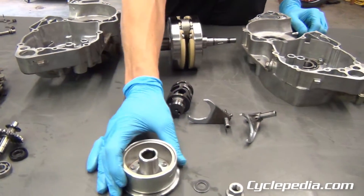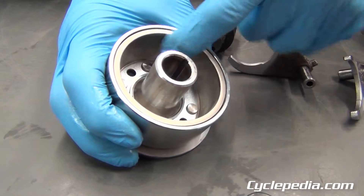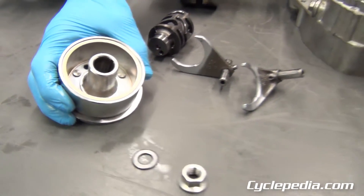Over on your rotor, you don't see it a lot, but sometimes check the inside of your rotor. These things can delaminate, and debris can get in there, causing problems.